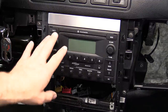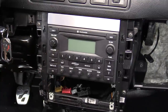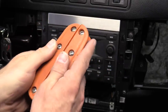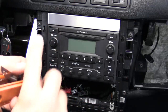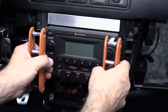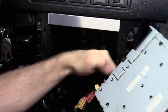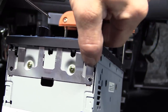Next up, let's pull this radio. This is an older style radio that does require radio removal keys to get it out — this is not just a VW thing, a lot of other manufacturers had this style of release. I've tried a bunch of different kinds of radio keys, and this one from Sirtool is the best one I've found — I'll drop a link in the description. First, we're going to slide the tool apart, fold out the long thin keys, put the key in the slot so that it locks, do the same thing on the other side, and then slide the radio out. We'll need to disconnect the quad lock, the big electrical connector on the back of the radio, and the antenna connector. To take the radio removal tool off, just push the spring in and that'll allow it to release.